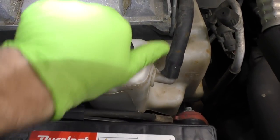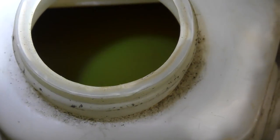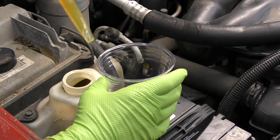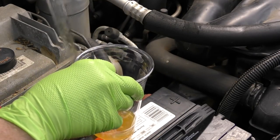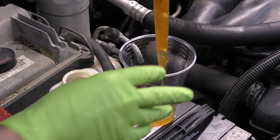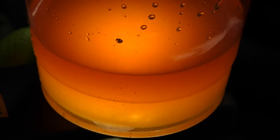Let's move over to the coolant reservoir side. As we look inside, we can see it's this reddish-brownish color coolant — definitely not the right deal. I'm also inside this reservoir smelling exhaust gas. Let's go ahead and get a baster and pull some of this coolant out and do a better evaluation of it. As you can see, this color is all kinds of wrong. They may not have done a coolant flush when they did the radiator, but draining the radiator drains the majority of the coolant out of the system. The radiator and thermostat were replaced probably within 1,000 miles. And if we shine a light up underneath it, you can see a bunch of deposits floating in the coolant.